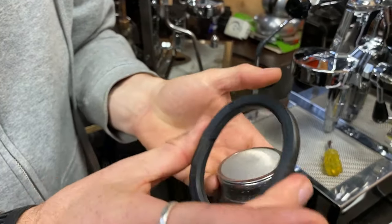If your lever is a bit squeaky, bring that in too — you need to grease it up. There's a cam in there which is brass on brass, and it's going to wear out. You'll be up for a whole new cam rather than just getting a bit of grease and fixing it early.